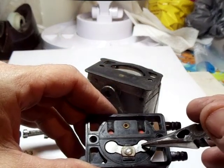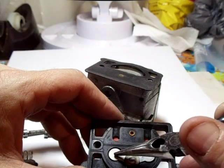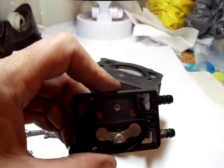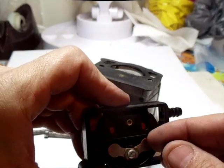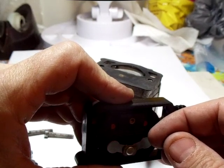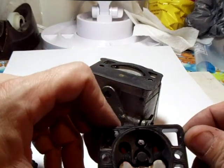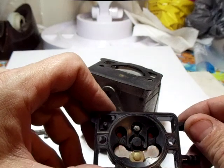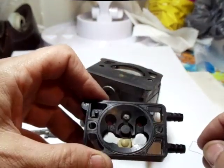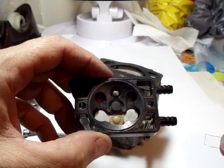Note how they basically just don't bounce much — just a paper thickness maybe between the reed and what looks like a rubberized o-ring. I can flex it a little bit with my fingers, but don't do it too much; put a bend in there and it's gone. What happens is those reeds on their own lift up and they don't seal properly with the vacuum. So normally people would have to buy a new kit, but not too cheap.